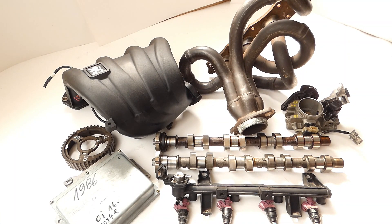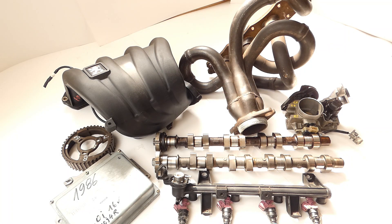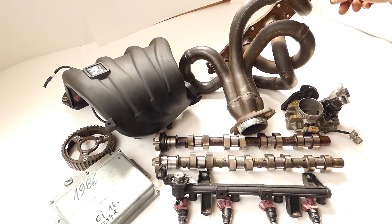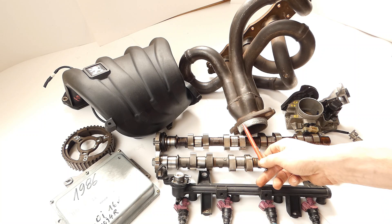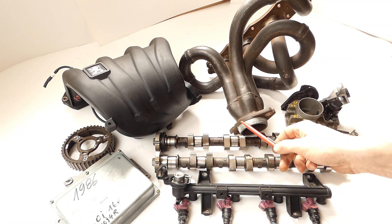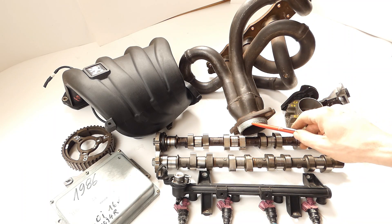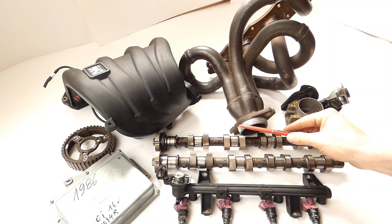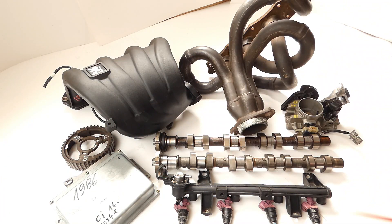This would now be the fourth variant, and now we have essentially changed everything at the cylinder head related to the intake side. As you can see, the fan/header exhaust manifold from the XU10 J4RS has now been added. It also fits the cylinder head of the XU7 JP4. Only the outlet is a little different and may need to be modified at the end. The heat shield from the Xantia is a little different compared to the Xsara or Peugeot 306 - that doesn't fit. But I'm working on it and will show you the result. What else comes in is the exhaust camshaft from the XU10 J4RS.